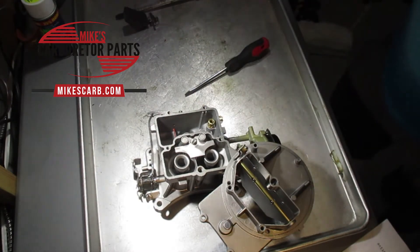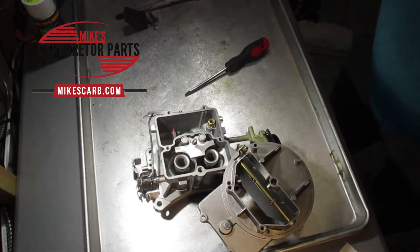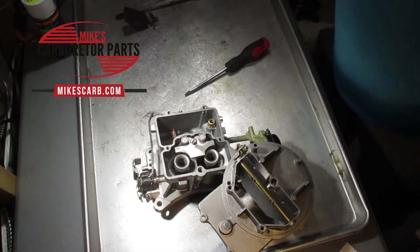So the logical question is: how can you possibly determine if changing the main jet is really necessary, and how to know whether a smaller or larger diameter is needed? Here's a tip: read the spark plugs. When the carburetor is properly tuned, spark plugs should be completely dry and have a light brown or tan color. When spark plugs show that condition, leave them alone — don't change the jets thinking you're going to get better performance just by making the hole bigger; that's not going to happen.